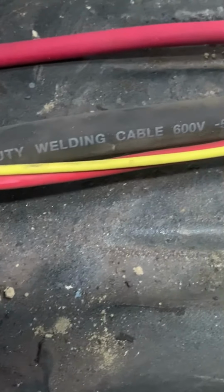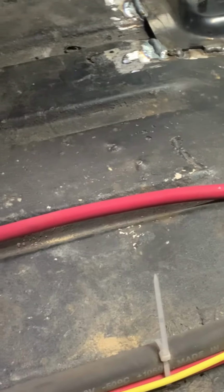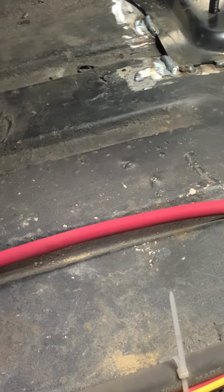This is a very thin strand wire. I can go in the trunk and show you a little bit more. But just trying to run them underneath the carpet where they're going to lay at. This would be kind of laid like that. Runs up. I got a bulkhead for the starter cable, and then I used hose glands like David Freiberger talked about for running the other 2 wires through the firewall. Now my 4 gauge, I don't have anything to run it through, so what I'm thinking is adding another one of those electrical bulkheads and then keeping the starter and the alternator separate.